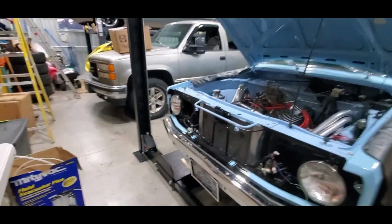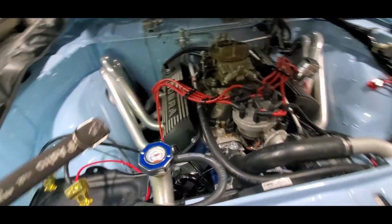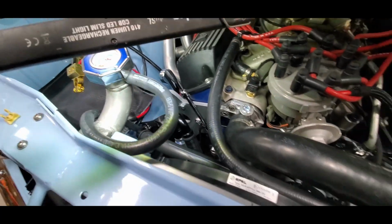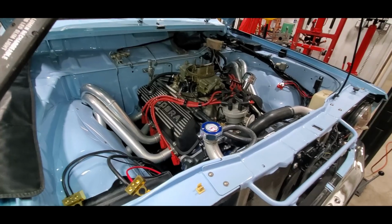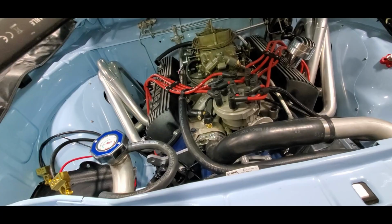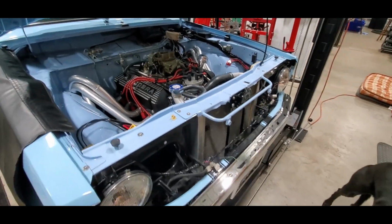The other thing to notice is, see the coolant sitting here? Well, that means that leaked. So, if I've got to deal with all this, it's not my favorite, but I think we're going to drain the coolant down a ways so we can pull this and clean that up too. Bummer. It didn't leak before, but then we changed to this one so we could have a future sensor port, and it leaked. I've got to feel and find out exactly where so it doesn't do it next time.